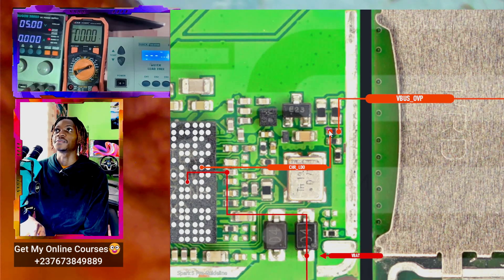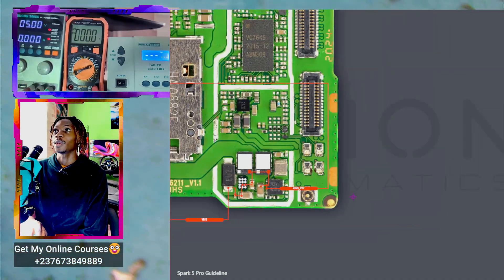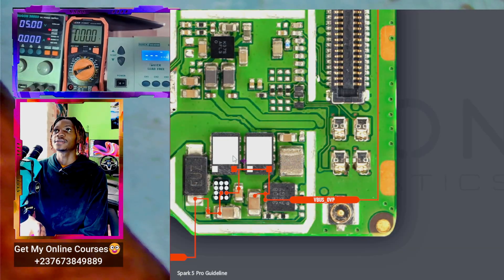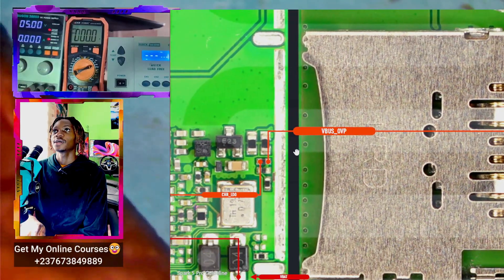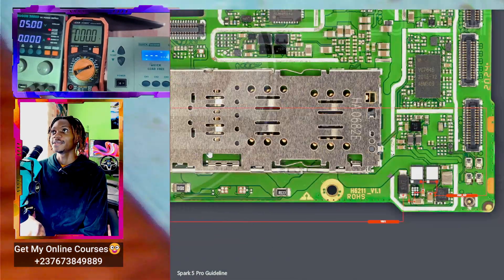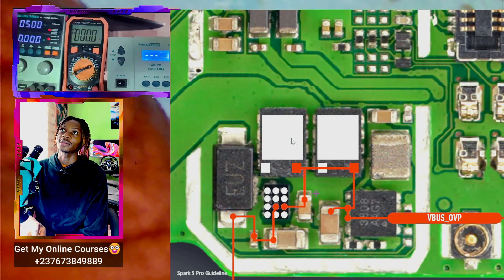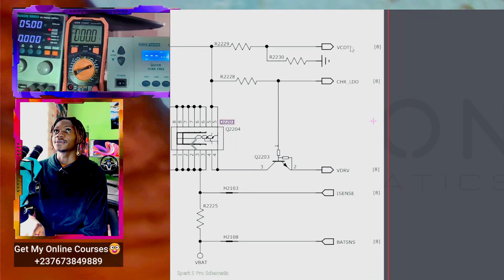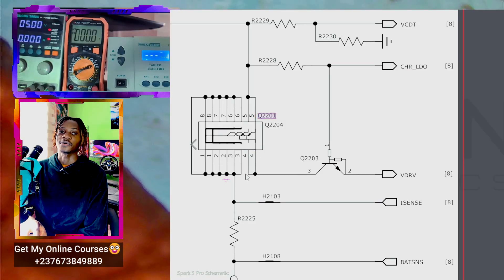You have to get that voltage out of this resistor. One of these ICs is suspected of causing the fault, but we'll do some tests before touching anything. If the charging LDO is not available, these transistors will not get the correct enable signal to pass out the correct voltage to charge the battery — because the LDO line is connected to the enable signal of these transistors.